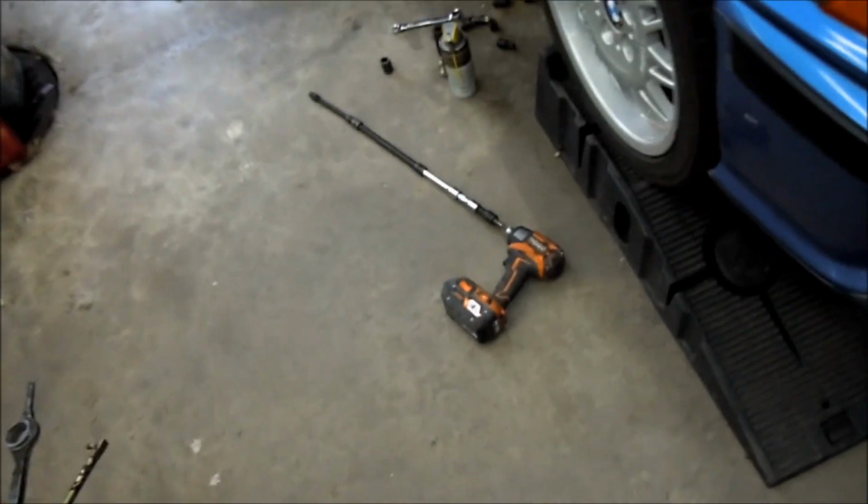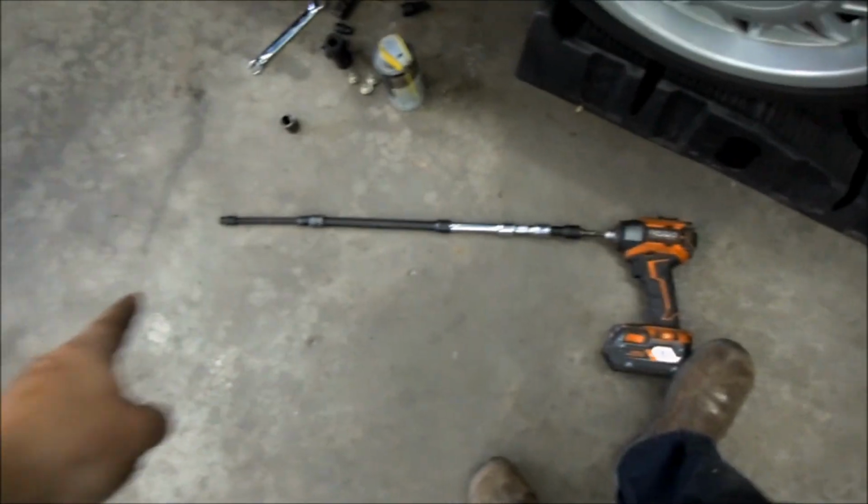And then I could put the new trans on, put the clutch on, align it right, all outside of the car, and it'd be so much easier. However, if you are doing it under the car, pro tip for getting all the transmission bell housing bolts: just get the drive shaft out and then get like 2.5, 3 feet of extensions and just go from the very back of the transmission. You won't need any weird swivel wobble sockets. You can just line them up straight from the very back, and typically that's really easy.